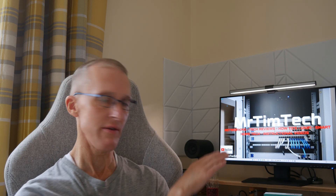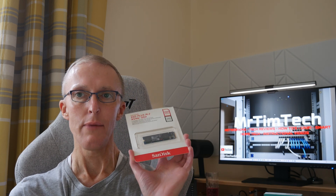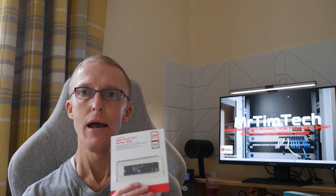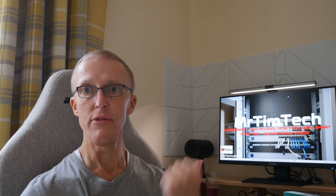Although there is already 256 gigabytes of storage in the GMK-TEC, what I'll be doing is taking that NVMe out — it's already pre-configured and loaded with Windows 11 — and putting it to one side. I'm going to use my own SanDisk SSD for Home Assistant rather than overwrite the Windows drive. I'll keep the Windows one just in case I need it in future and can simply swap the NVMe back.